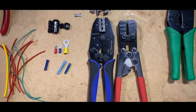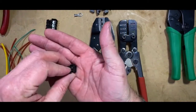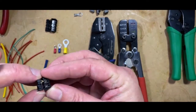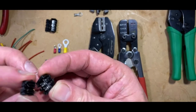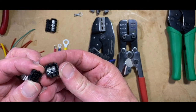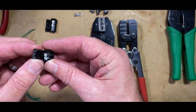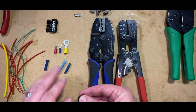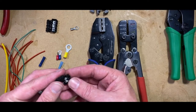We did want to look at connectors as well. Now, here they are. This is the insulation displacement connector. It's not a real favourite of mine. I think it's going backward rather than forward. I really don't know what to say about it, but one of the manufacturers in the UK, BMW, has said that that's the connector they want used on their installations. My opinion is no. I'd much rather use a crimp style connector or even soldering on a job.